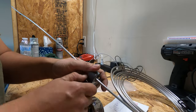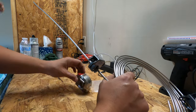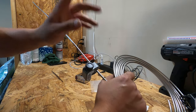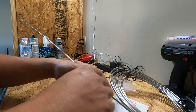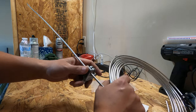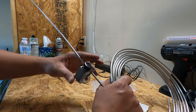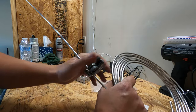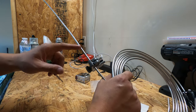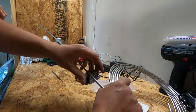We spent more time making a dummy than actually bending the line. That's a good tool to have, though. I usually have one straight one and one that's 90s. Because the 90 is your closed bend. You're going to be doing it repetitively like that. And if you're going to have a tubing that goes over it, you have to measure the tubing and add it to that closed bend so it'll sit over it.